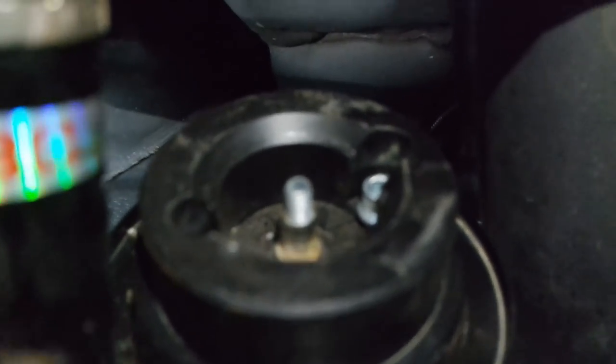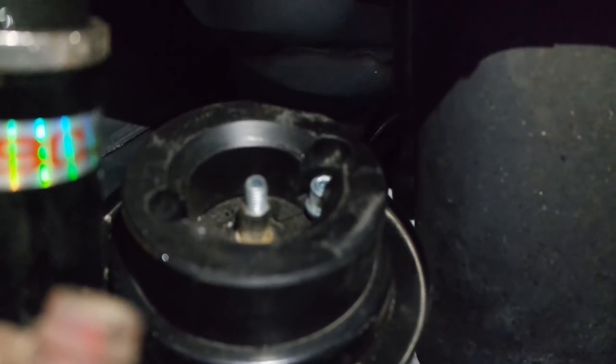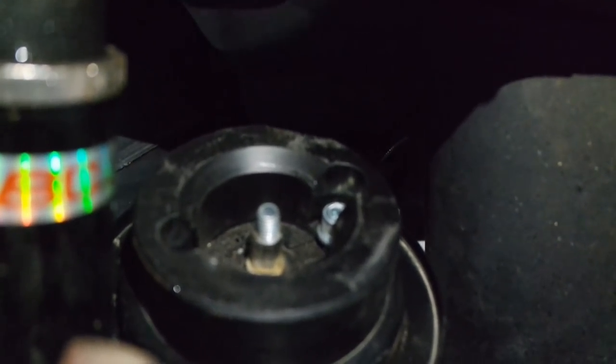The last piece of the puzzle is the rear airbag. There's a bolt in the middle — that bolt has to go through a small circle piece with a hole in it that's in the actual frame at the back of the car. The problem is it won't fit as-is, so what you have to do is drill that hole big enough for the bolt to go through. Once you do that, you're all set.